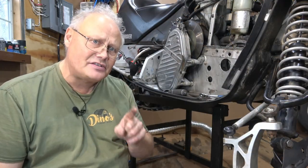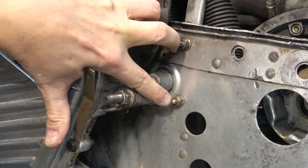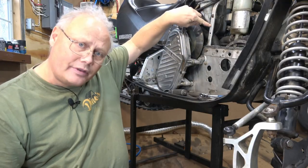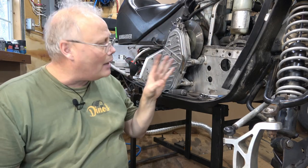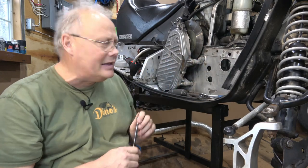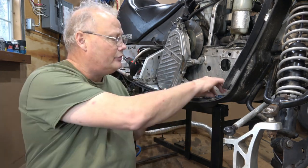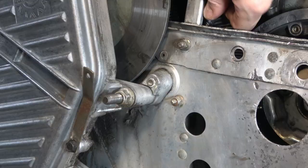The first two fasteners that I'm actually gonna take out are these two fasteners here. These support the handlebar bracket, or the handlebar support itself, and the bracket actually uses those to help register where you need to drill holes and also where I need to cut this factory support, because it actually goes in behind the brake caliper. I'll use that just with a couple 10 millimeter wrenches, so a box end and a ratchet wrench, and I'll take those out.